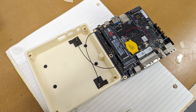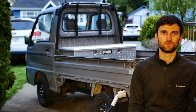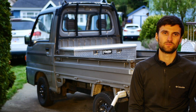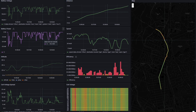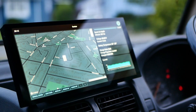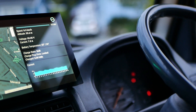There's also an onboard Linux computer that is collecting data from the various devices on the vehicle. There's a GPS on the roof providing speed and location data. There's a CAN connection into the BMS providing data about the cells, power consumption, state of charge, and those sorts of things. There's also a USB cable into the motor controller with real-time stats on the motor. All this data is logged to a database so it's viewable after the fact. And then there's a custom touchscreen on the dashboard that provides a lot of this information and a map of where the vehicle is live while you're driving.